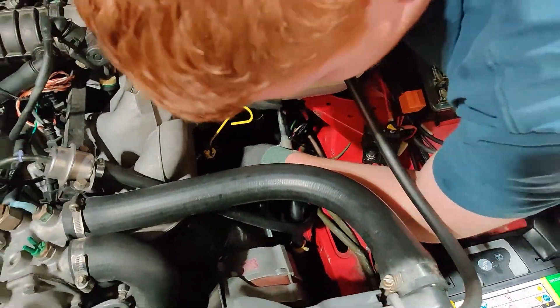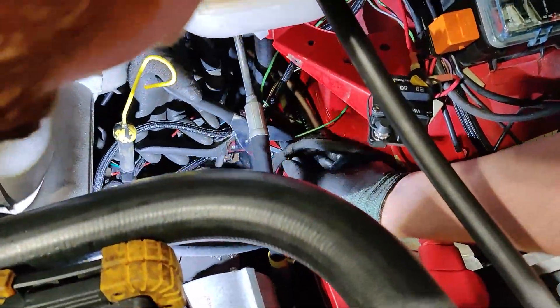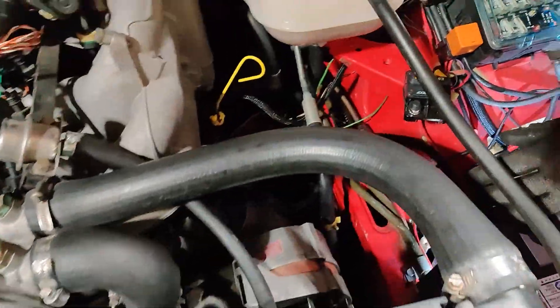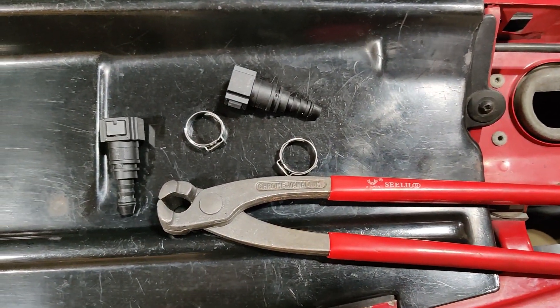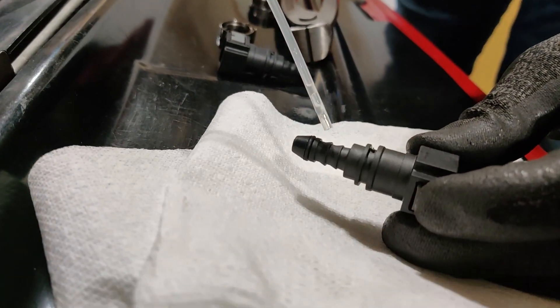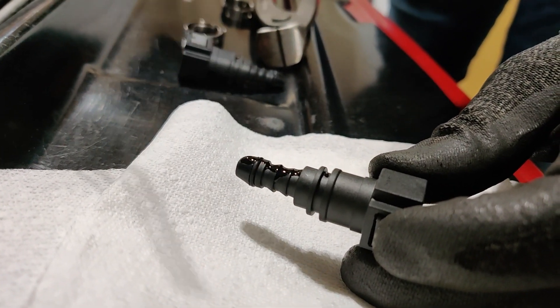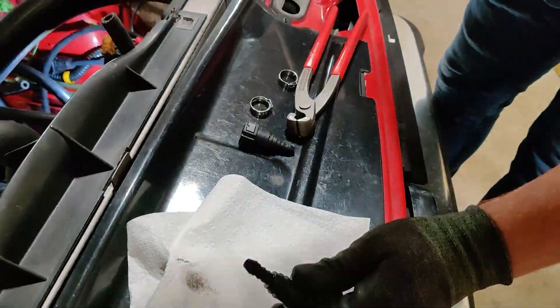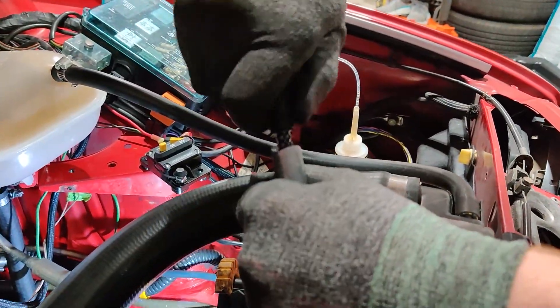Right now we're looking at the hose and finding a good spot to mount it. You typically want to mount the flex fuel sensor in a low part of the fuel system so that it can have a pool of fuel around it at all times. If you mount it vertically, especially under high load when you're using a lot of fuel, it will get air bubbles that go past it and there won't be a constant flow. I find it easiest to add some lubrication to the end of the barbed fitting, especially when using push lock. We're using Continental push lock 5/16ths diameter, and sometimes it will fight you, so just add a little lubrication before you try to get these things seated.